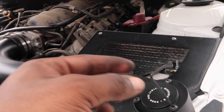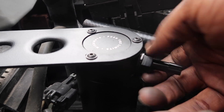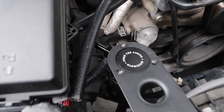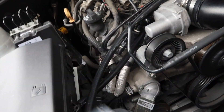When installing the catch can, take your allen key and unscrew these three bolts. You'll take the catch can and put it underneath with those holes facing and connecting to the three holes, then re-screw it in — just want to make sure it's tight so we don't have any leaks. After completing those steps, this is what it looks like: you got the catch can, your hoses ran, and the two outlets. Now you're gonna take the hose from the back of the engine and connect it to the inlet, and the hose from right here goes on the outlet. They give you little hose clamps — put them on each hose and connect them.